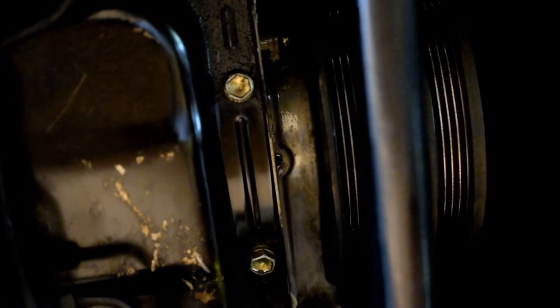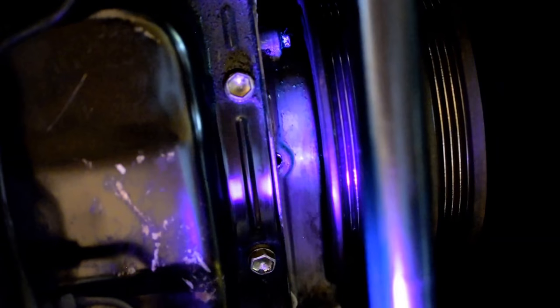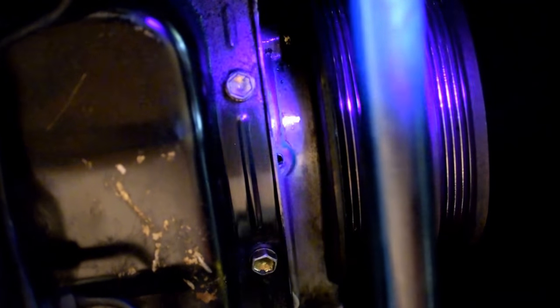Hopefully you've got a really good view of this — it is pretty telling. We're looking at the underside of the crank pulley. This is the timing cover. This is the oil pan. I wiped this clean just a day ago or whatever that was, so you can see how well that's glowing — that's fresh oil, and you can see it dripping down from there. I think it's definitely the cam seals that are to blame, at least for most of it.